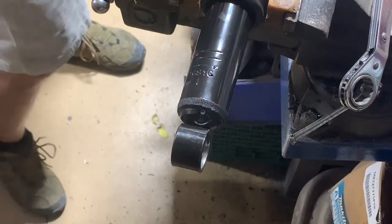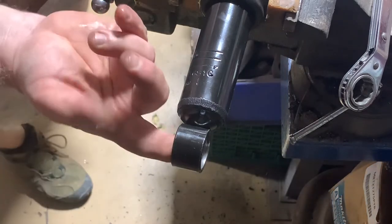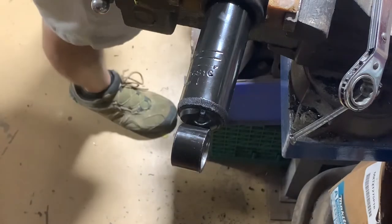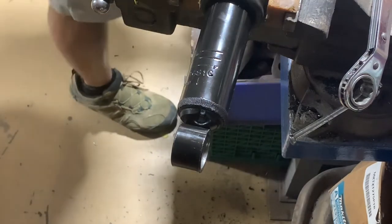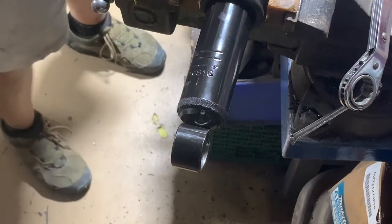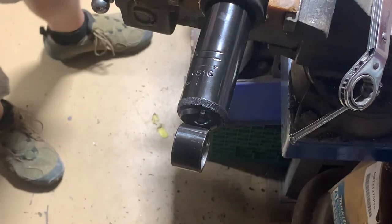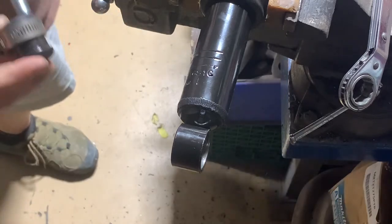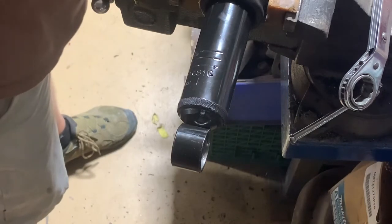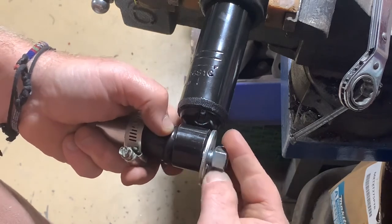Clean out the rubber, I put in a little bit of oil right here. Still kind of warm. Now to get the new sleeve in. I said real time and I'm losing the sleeve. Put a little bit of oil on the sleeve, slide the sleeve on, and slide the sleeve on a bolt and put a good size washer on.